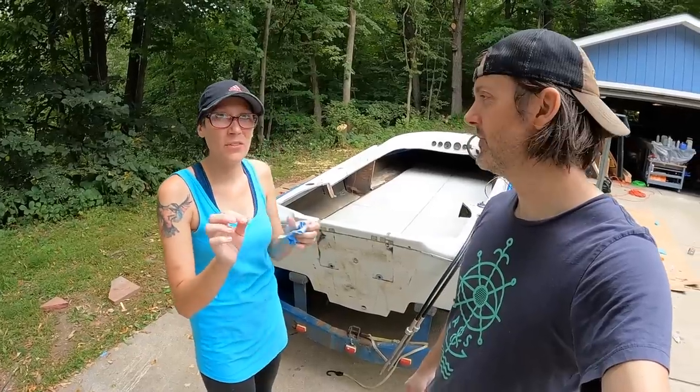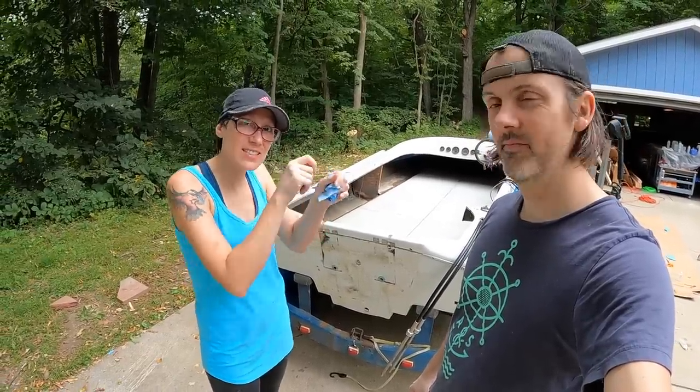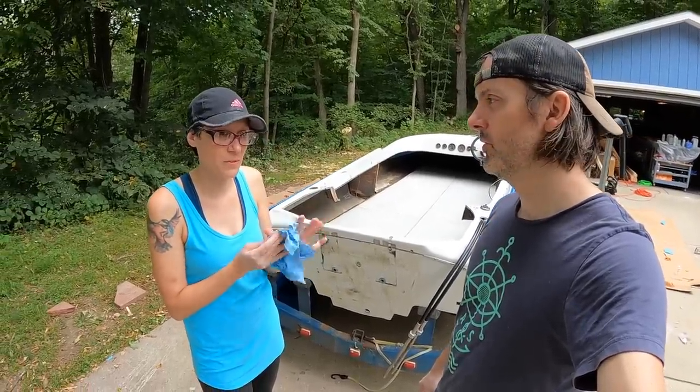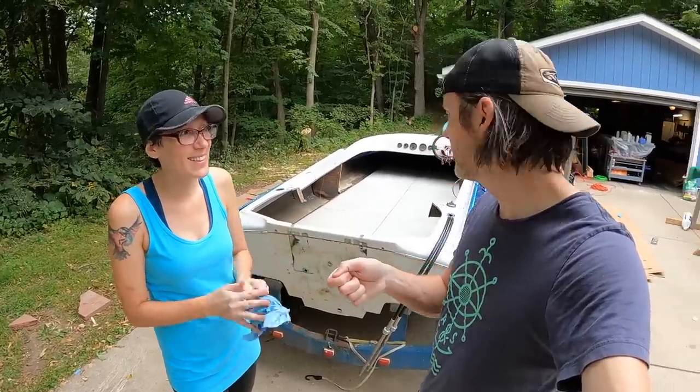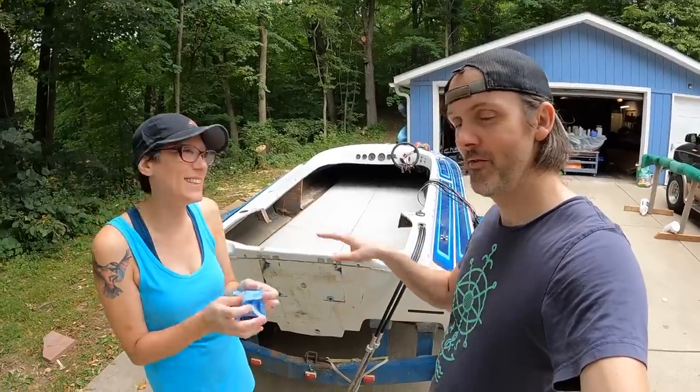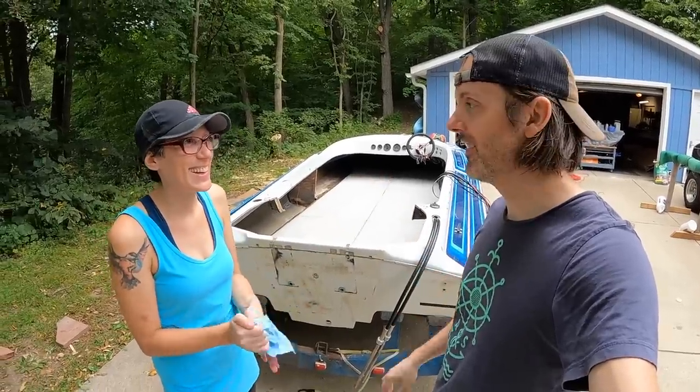The lighter weight cloth was a little fidgety, like you had to do little tugs to keep the weave straight and not have bubbles. Where we'd been using some of the heavier stuff, that wasn't quite as big of an issue. With the heavier weight you could almost roll out the bubbles, but with this the bubble would fold on itself. So what you wanted to do was just go to the very edge of the fabric and do a little tug, and from 4 feet away that bubble would go away. Yeah, it was kind of cool.